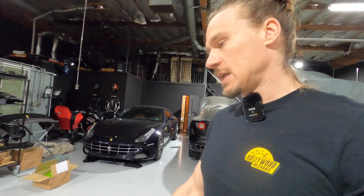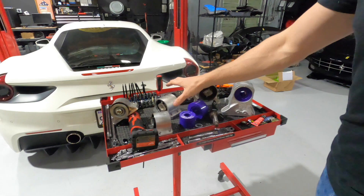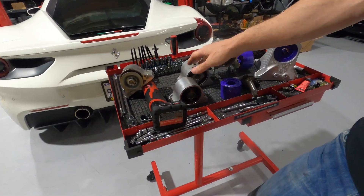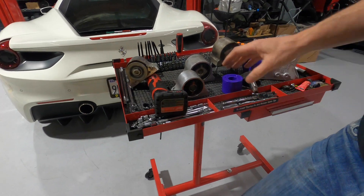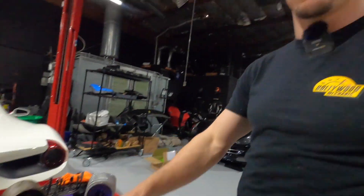We're excited about this. We're going to sell them as pairs, with options for pairs or complete vehicle sets with a little discount. The front mounts — as they stepped them up and made them larger — are easier to remove from the vehicle. You can remove these while the car has the transmission in it. You may have to loosen the exhaust pipes and heat shields, especially with the larger Monza, 812, and GTC. Those are the ones I see failing most often.